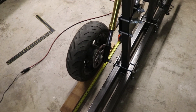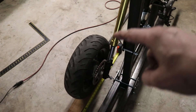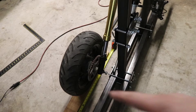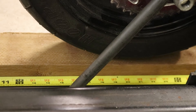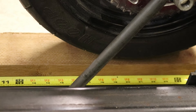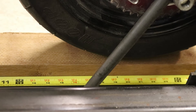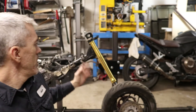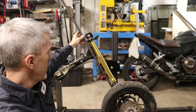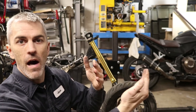I've got a tape measure on the floor and a piece of pipe to represent my imaginary steering tube line coming down. Where the contact patch for the tire is, you can see that's right around 20 inches on the tape measure. At the current rake, that puts me at about 15 inches for the steering line, making the trail about five inches — more than we want. If I move it to 27 degrees, that should put me at about 16 inches, which is right on the edge of four inches of trail — the standard upper limit.